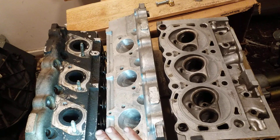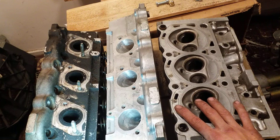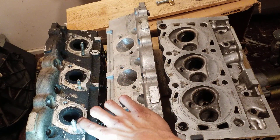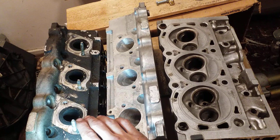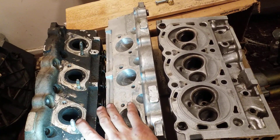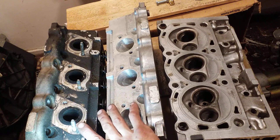The reason why is the difference between a ported head and a non-ported head on this vehicle means a lot to specifically this area of the head. So when you buy the vehicle and pull the head off the engine, you're going to have this look to it. What's going on is this is a stripped head from a Ford Freestar. And when you look at this rim around where you pull the exhaust manifold off, there's heavy blowback on this.